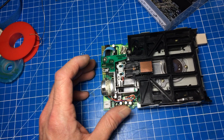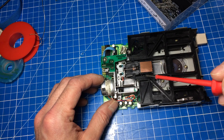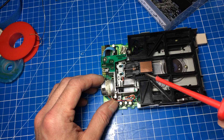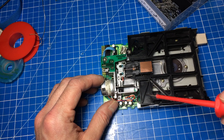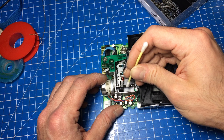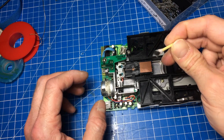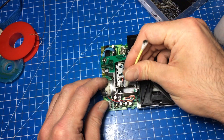As you can maybe see, there's the axis that is moving the head back and forth. It is lubricated, but you can still see some black crusty stuff on there. We're gonna remove that and add some new silicon grease, which is probably what this was lubricated with before. Look at this — this is what remains of the lubricant, which I suppose was white or clear at some point when it was applied.